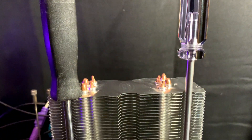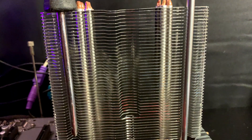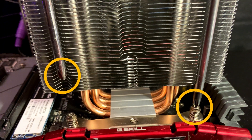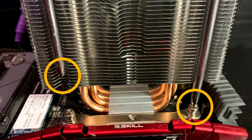A regular Phillips screwdriver won't work when screwing down the Air Cooler — the barrel is too short to slip into the V-shaped groove in the metal fins. You will need an extra-long Phillips screwdriver, like the Be Quiet screwdriver that comes with the Dark Rock Pro Air Cooler. Be careful when starting the spring-loaded screw on these posts; if the screw tip slips off, it could damage the motherboard. This part of assembling the Air Cooler I'm not too crazy about.